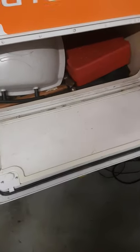Some of the other stuff — now's probably a good time to open up everything. The little hatch here, give the rubbers a rub with some silicon spray, get them open and give that rubber a rest — don't keep it under load all the time. Same for the camper. Most people can fit their campers inside the garage. I've got the roof up — all those rubbers, give them a clean and a little bit of silicon spray, and give them a rest with the lid open. If you're outside and can't have it in the garage and you've got a cover on it, the minimum you can do is undo your latches underneath the cover, take that pressure off the rubbers and let them come back to their full size.